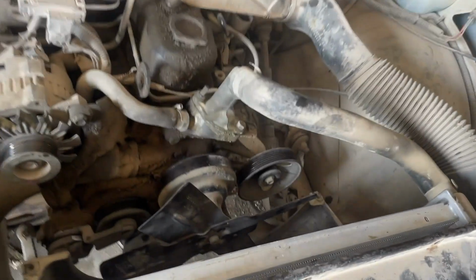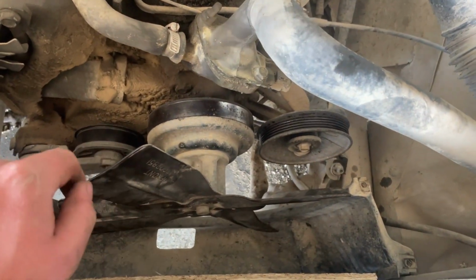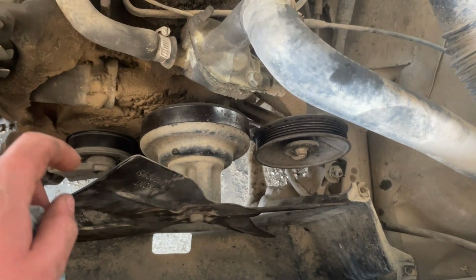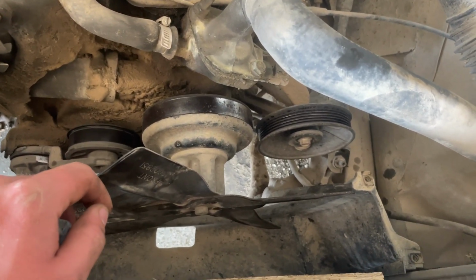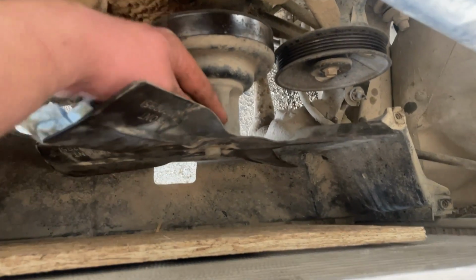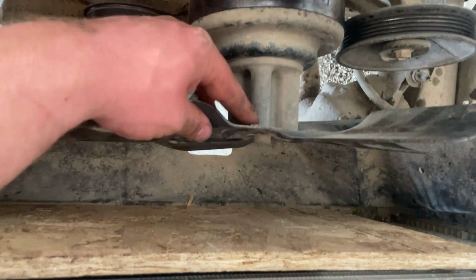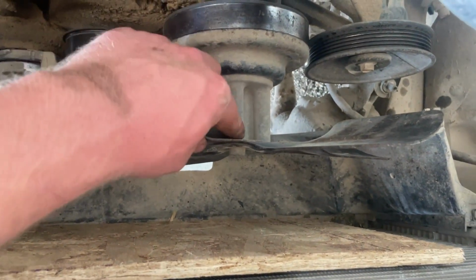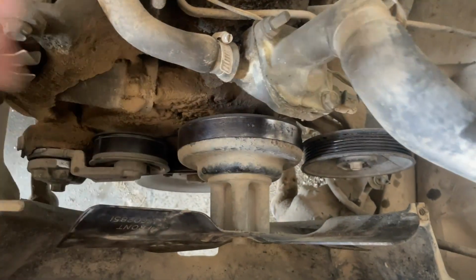So in my videos, I normally talk about a lot of things that you really shouldn't do, but you can do. And they also normally involve hammers, like whacking hydraulic cylinders and stuff when you put an engine together. So we're gonna do some slight tapping to try to get this fan popped off. We've got the cardboard in there now, because we'll have to get this off and try to get that pulley off. Otherwise you can't get to the water pump nuts.